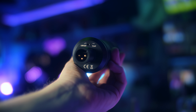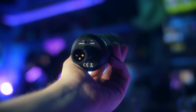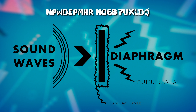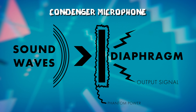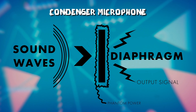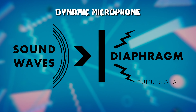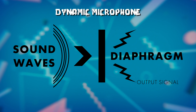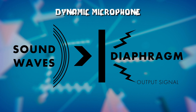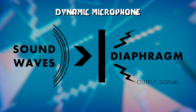Now, the sound of this microphone is likely to be much more different than what you're expecting. It is a dynamic microphone, which means it's better at rejecting background and ambient sound compared to condensers — better for desktop streaming situations with keyboards, mice, controllers, and desk reflections. But it's tuned very weirdly. It's a hyper-cardioid mic, which means it's supposed to only pick up right in front and start to color your voice once you get off to the sides.